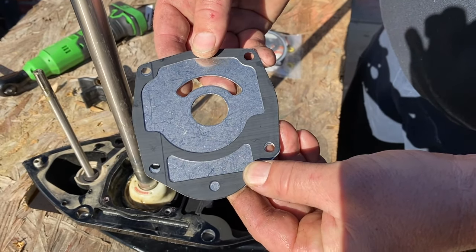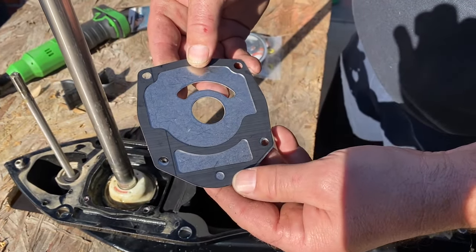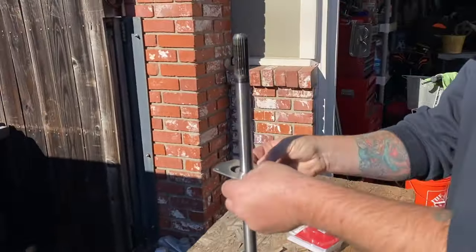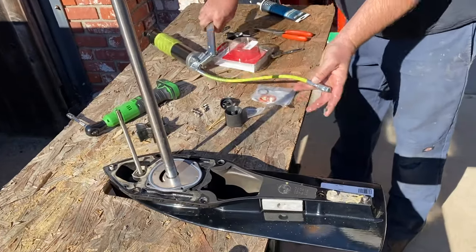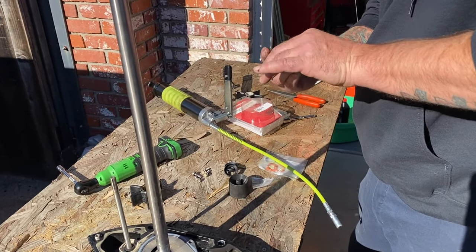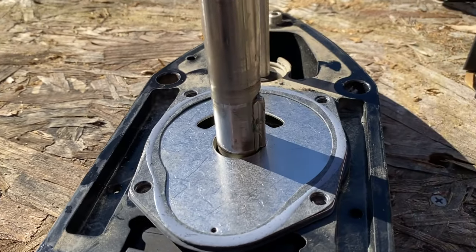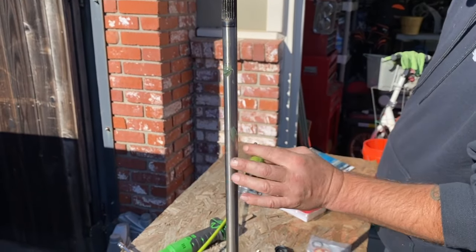As you can see, that's wrong — it's covering that hole and these are all a little off, so be careful. You can't put this on upside down. That is correct. Keep these all nice and lined up. We're going to put this keyway on with a nice little dab of grease to hold it in place. Slap that on there — there was a flat spot there. Put that grease in so it holds there. Also put a little bit of grease — not a lot — it'll help with sliding this down.